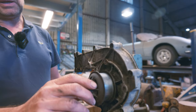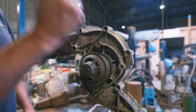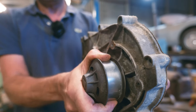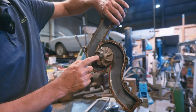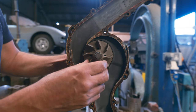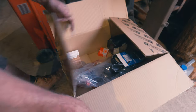Let's have a quick look at the water pump - the belt runs on the back of this. You'll hear it's quite harsh when I spin it. And if you tap it, it jars a bit. And if I get hold of it and rock it, see how much movement there is in it - the bearings are starting to collapse. If I turn it around so you can see the other side, you can see the impeller - that's what drives the water around. This is plastic. You used to get these dropping off on VAG cars - quite a common thing. So that's why we're putting a new water pump on it.